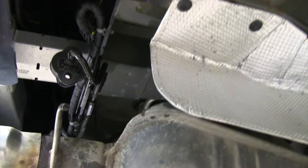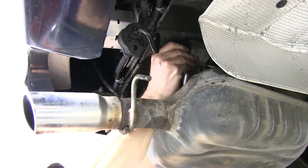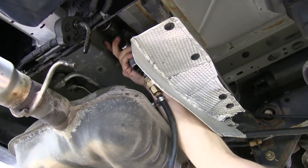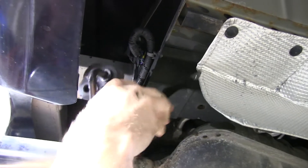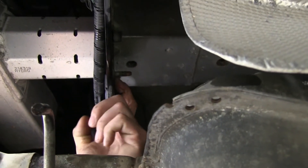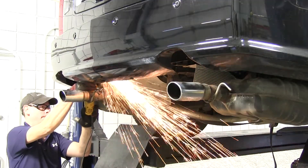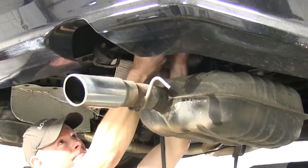The next step is to remove the metal part of the hanger from the vehicle. There are three bolts to remove: one on each side of the frame and one on the bottom. We have to do that because this lower stud right here — we actually have to take a cutoff wheel and cut it off as flat as possible. When we've got our driver side done, we'll go over to the passenger side and remove that bracket as well.